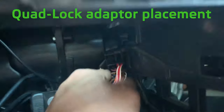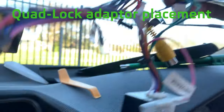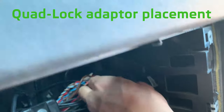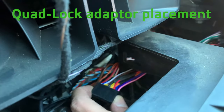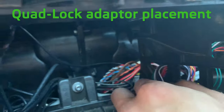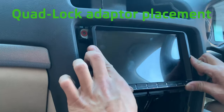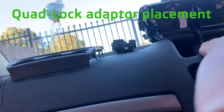As we saw before, fitment of the head unit wasn't working, so we decided to move the quad lock adapter into the little space to the right of the head unit cage. What needed to be done was also lifting the little storage compartment back up, so you're able to maneuver the adapter into place outside of where it would normally sit. Feed the head unit's slim plug through a little hole, then join the quad lock adapter while it's in this section on the side of the usual cage. With that quad lock adapter out of the way and other things moved aside, you're able to push the head unit all the way in for a snug fit. It took us a few hours to figure this out, so hopefully this saves you time.